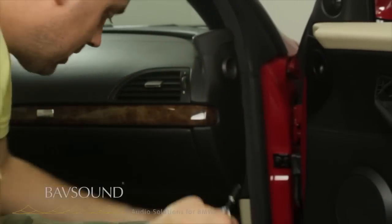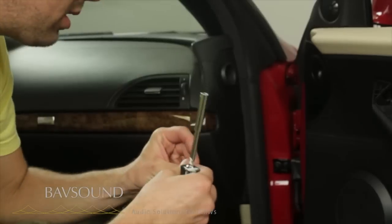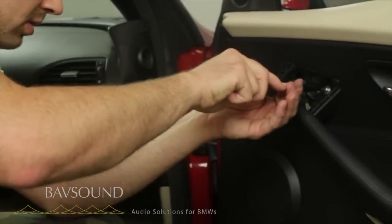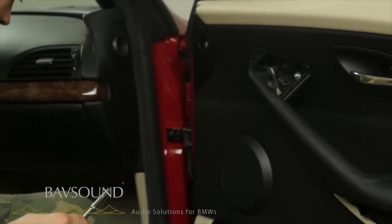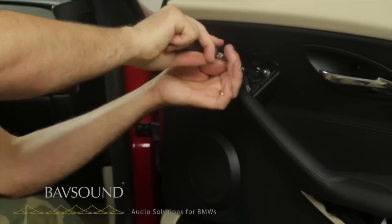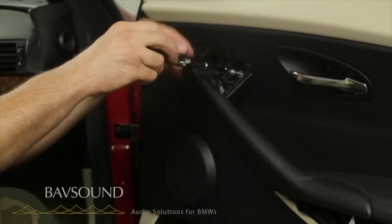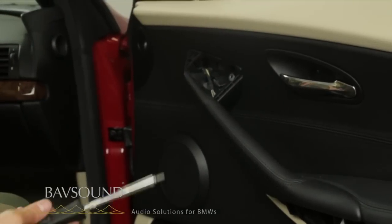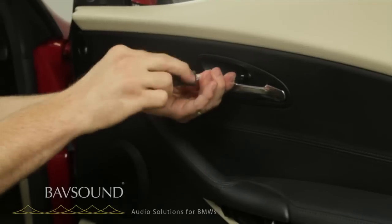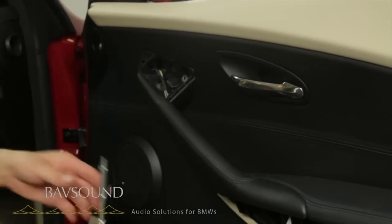So let's go ahead and pop this Phillips head bit out, then take the other four screws out and this panel comes right off. It's really straightforward. You really wouldn't think a hundred thousand plus dollar car would come apart this easily, but like all BMWs, completely over-engineered. Actually, those are T20s — my bad. You've had a bunch of cars in here today, so your sixer has T20s.